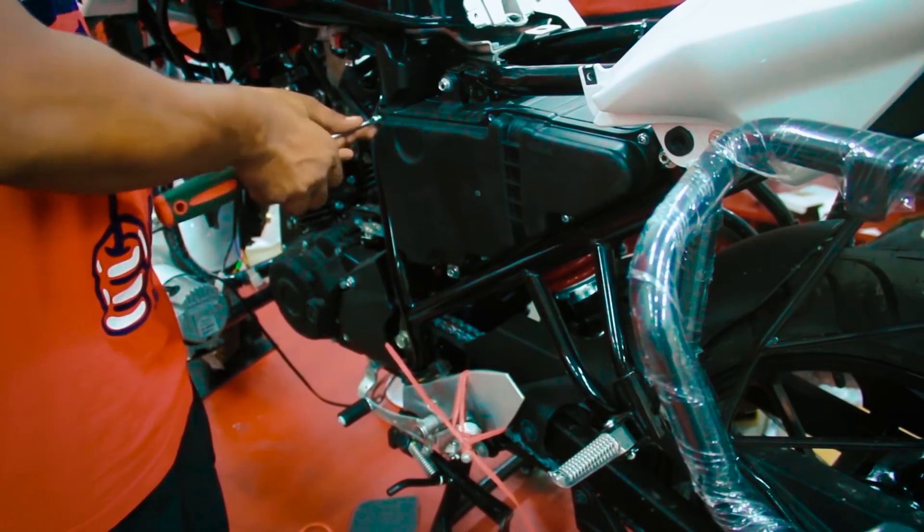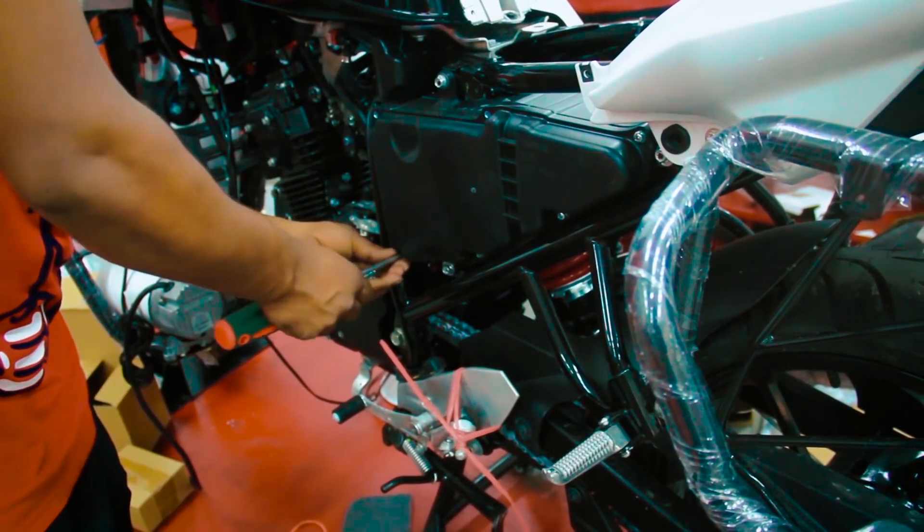What we now call maintenance: for dry air filters, you clean the filter element itself and it can be reused, but only for about three services. For the viscous type air filter, there is no cleaning in maintenance — it must be replaced. This will be changed at the same service interval. Every 8,000 km or 12,000 km it will be changed accordingly. It depends on the riding situation.